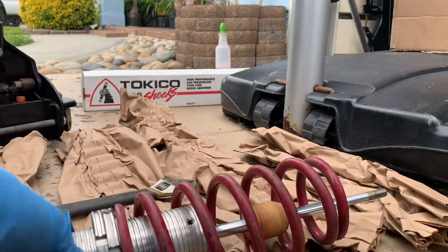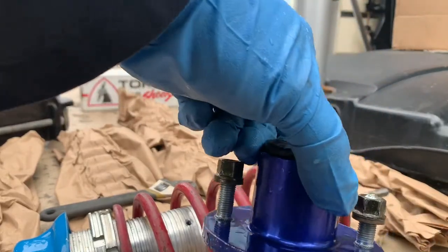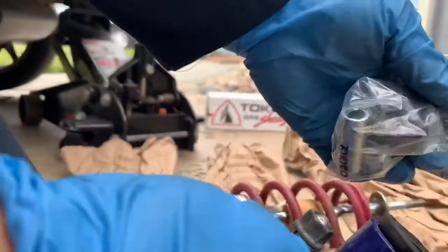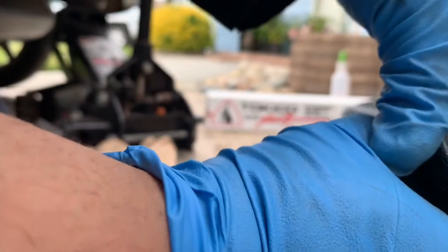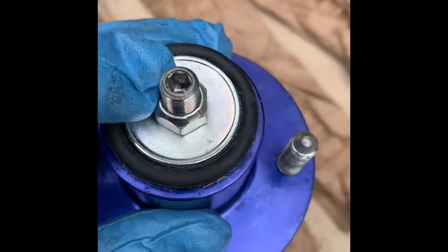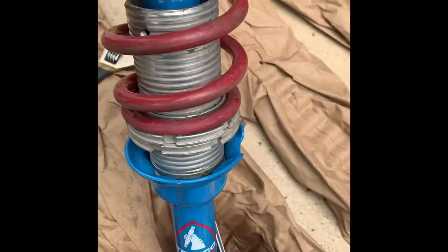This is the junkyard score I got from last month, so I'm going to replace the three-inch top hat with one that's about one and a half to two inches. You'll need an allen wrench for this. Make sure you install the proper bushing — they gave you a new one. I'm going to take the old one out and put the new one in with the nuts and bolts. I got it installed: new rubber bushing, new nut, and a washer. Now it's ready to put back.